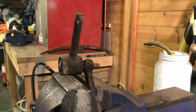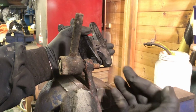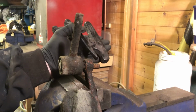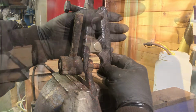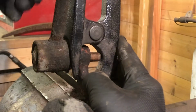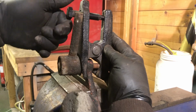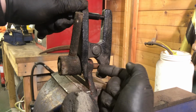You know, sometimes filming this stuff takes longer than actually doing it. So what this actually does, rather than just bashing it into the gap between these two and pushing one off just by driving a wedge in, is slightly different. You basically put this end into the gap. Normally it just fits in, and it cups against whatever's here. This end is going to press against this screw thread, and if I tighten up this against that top arm, there we go. You can see that as that tightens, this is going to stay where it is. This is going to start pushing in on that screw.